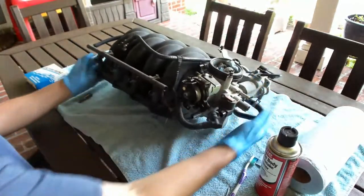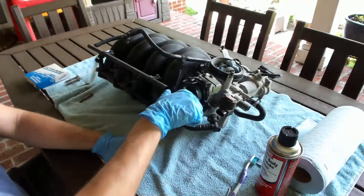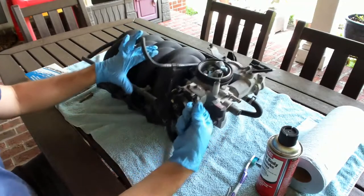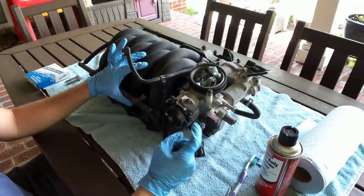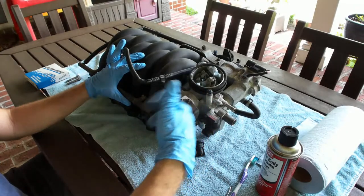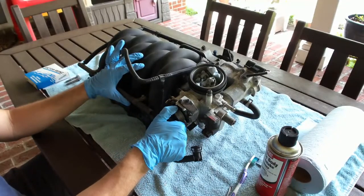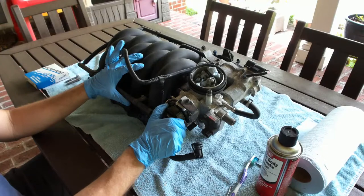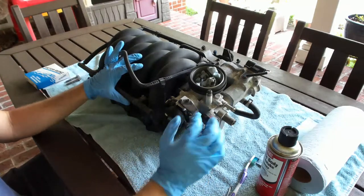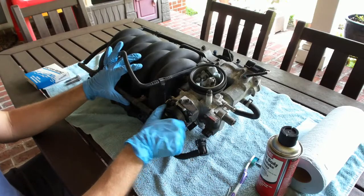Basically, here you take off the throttle cable. Right where the throttle cable lays in, there's a little zip tie and a grommet. You have to undo the zip tie. Don't let it spin too far or too fast. If you spin it too far out, it'll actually tighten the cable. When you start the car up, the throttle could be open quite a bit and rev way up on you. So you want it to not really have a lot of play, but not move the cable, obviously.